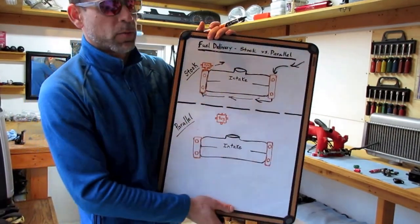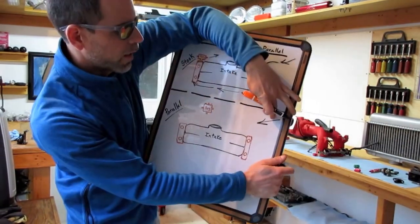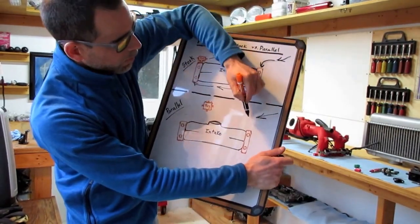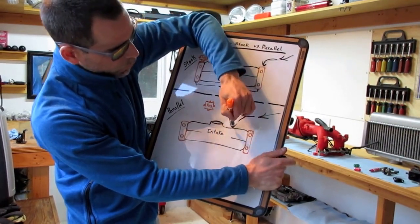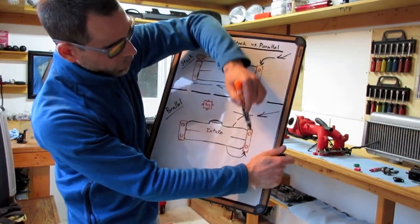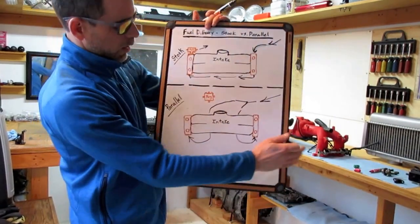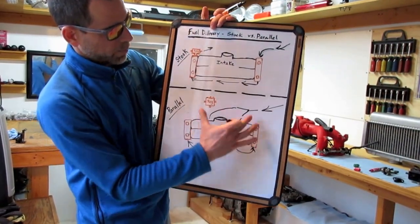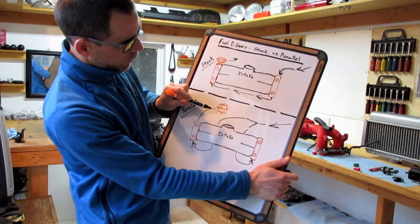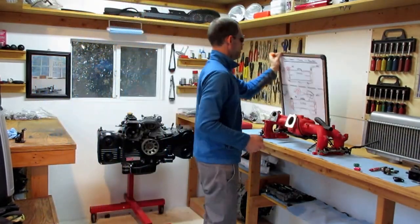So that's a huge preventative thing for any high-horsepower motor — make sure you never go into a lean condition. That's what the parallel fuel system is all about. The fuel line comes in from the gas tank and hits a Y-splitter. The Y-splitter sends one line to the front of one fuel rail and the other side to the front of the other fuel rail, so both rails get the same pressure. Coming out of both fuel rails, the lines go into a regulator.